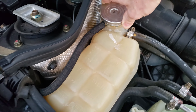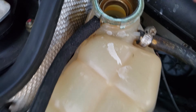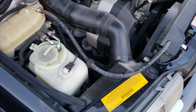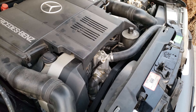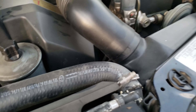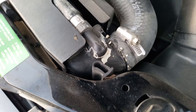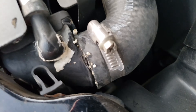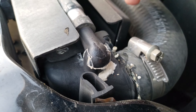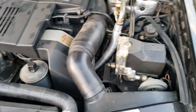When I was looking at the car it had no coolant in it, so I filled it up with coolant, started it, it didn't run great, then I rechecked the coolant level and it's lower — and it smells like oil in there now. So it needs a head gasket. But I have an engine sitting at work that's going to replace it — got to transfer over a ton of parts. I was also looking at this — that might have been what caused the coolant to disappear in the first place, causing the engine to overheat and the head gasket to blow. You can see right there, I think there's a small crack right down there. I bet if I lift it up it'd probably just crack off. But everything else about this thing is insanely clean.